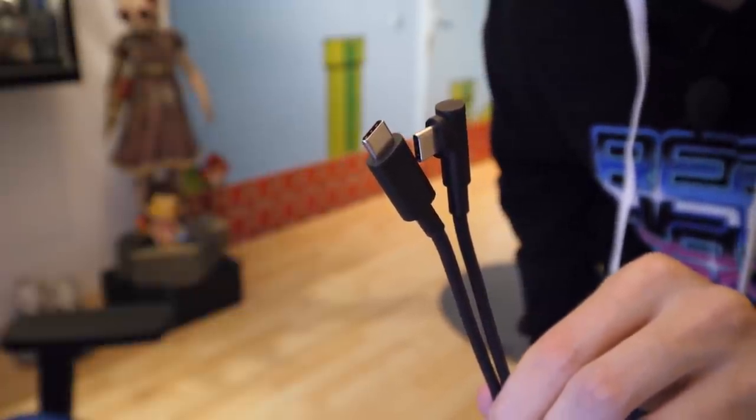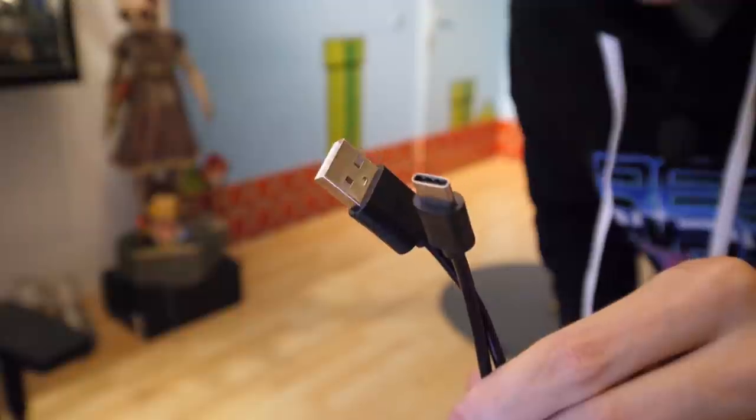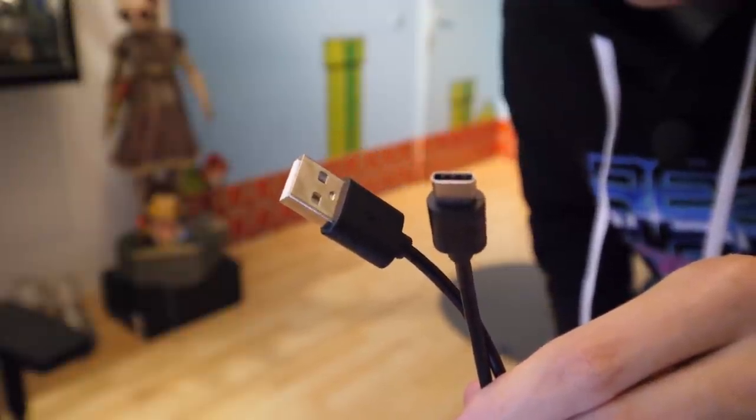There are two cables you can use for this. You can go for the charging cable that comes with the Oculus Quest — this is a USB Type-C to USB Type-C, by the way. But this is only for folks who have a motherboard that supports USB Type-C. If you don't, then you have to buy an extra cable — a USB Type-C to USB — and this works exactly the same. If you're not completely sure what you have, just go to your computer, go to the back, look at your motherboard and see what ports it has. Maybe you're lucky, maybe not. But these cables aren't that expensive.